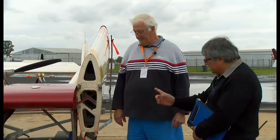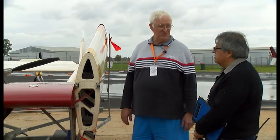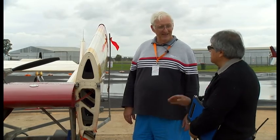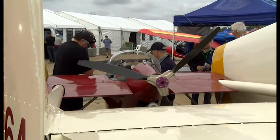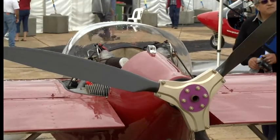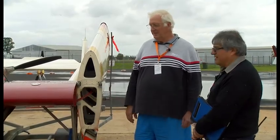What about the landing system — is it retractable? No, it's fixed. It's the simplest aeroplane you'll get. It's got rubber and compression as shock absorbers, which last about five years without any looking after. It's a very rugged undercarriage system because it was originally designed for taking off from really rough airstrips, not nice ones like we have now. We've got a Bolly three-bladed carbon propeller on it now. With the HKS motor you can really feel the difference compared to the Rotax 447 — the four-stroker definitely pushes way better.